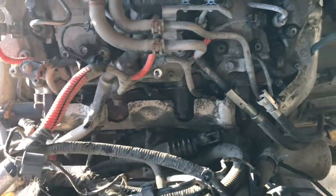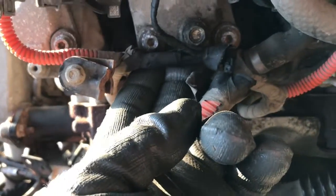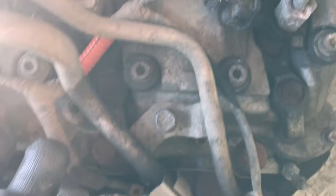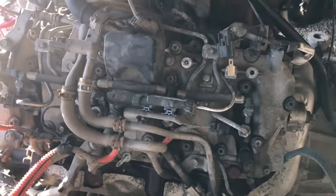It's got the glow plugs unhooked. Towards the front side, this bolt holds the glow plug wiring, and going to the back, it's got the other one that sticks over this long stud here. Pull the wires off as they come along off the injectors, and then the wiring harness is about off the motor.